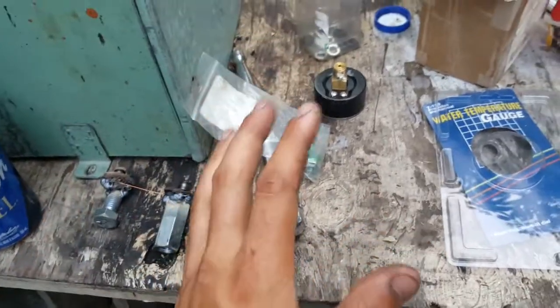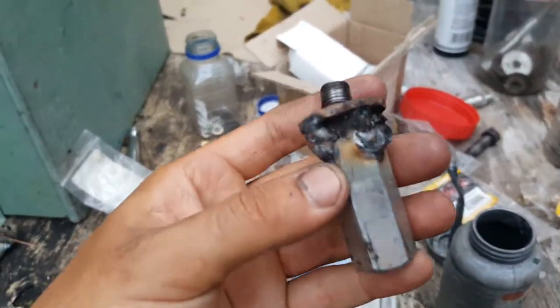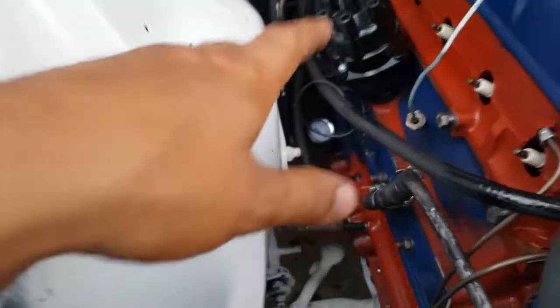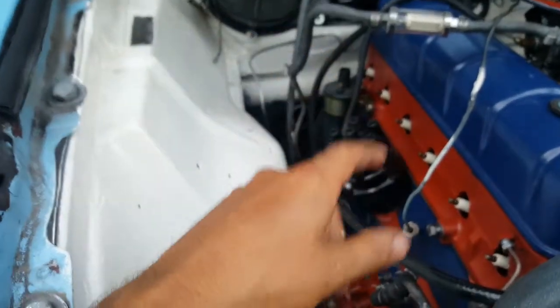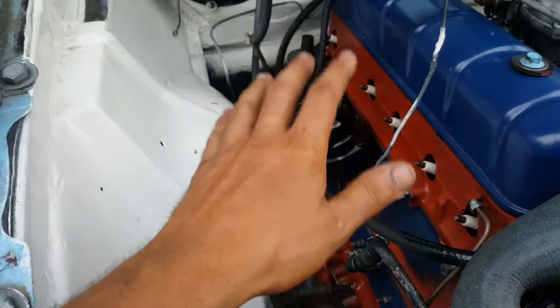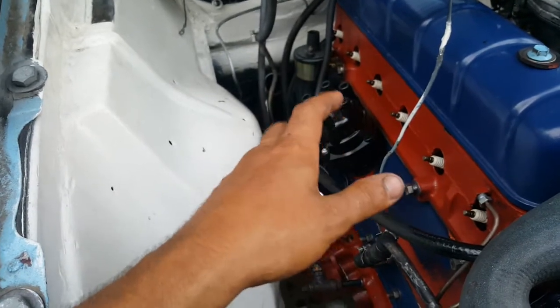But before doing so, just remember, this is my third tip, third word of advice for you. Remember to take the plugs out if you're installing gauges and things like that. Remember to take plugs and bolts out before putting the engine back in the car, because it makes everything easier. If it breaks or if it's broken, then you can weld or you can drill it out.